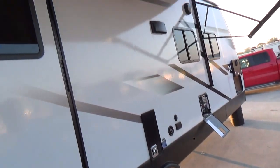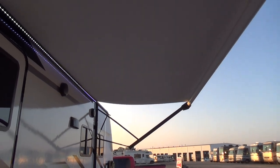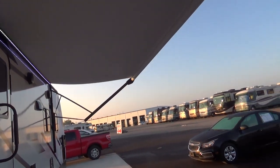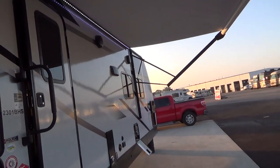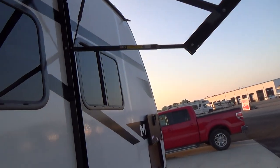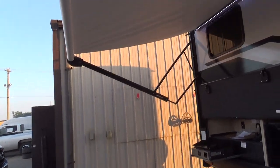Your awning is completely out with the awning lights on. Your awning is just for shade control — it is not meant to be out in stormy or windy weather, so bring it in when it's stormy, when it's windy, and bring it in at night. You can lower it to get better shade control by pulling these arms down — you can pull one or both. You can leave it out in a drizzle if you need to, but if you do, make sure you pull down both sides so that rainwater will shed off and not pocket on the unit.